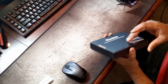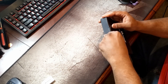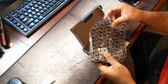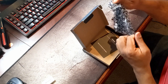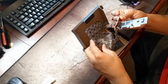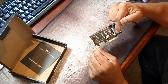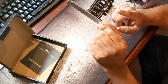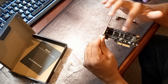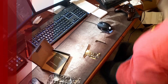Let's see what's inside. I only have one M.2 NVMe slot in my motherboard right now. So here's the low-profile bracket. I'll have a link in the description for the exact brand and everything I'm using here. Some silica gel which I don't need. This plugs into the PCIe 4X slot on my motherboard, and I just put my NVMe card right here. Windows 10 should identify this. It also comes with little screws and stuff.